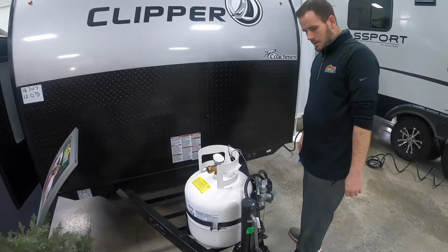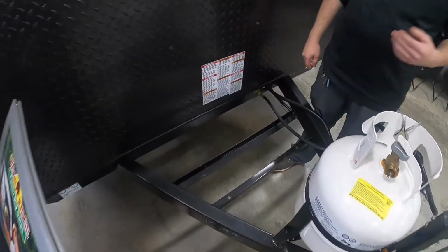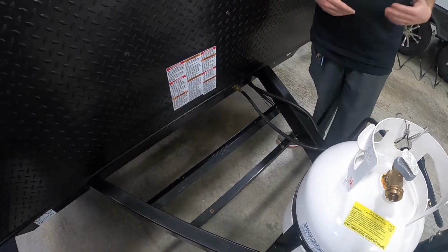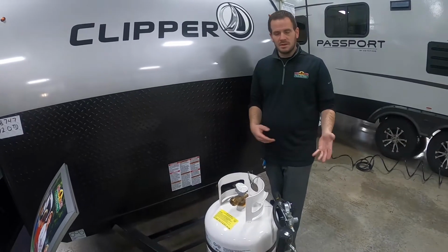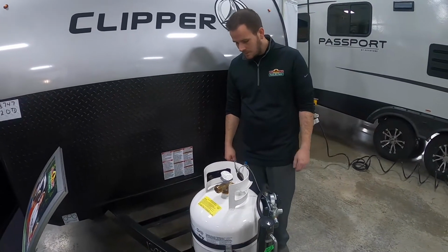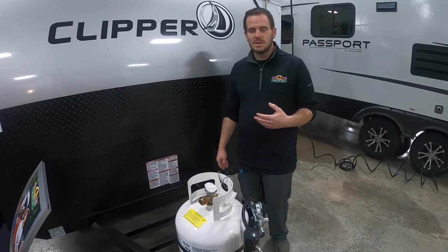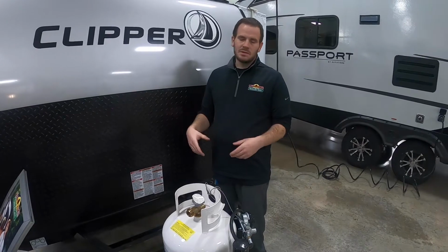Behind that you'll have a 12-volt deep cycle marine battery that's going to be able to run your lights and your water pump and little things like that. If you are dry docking or pulling over on the side of the road somewhere, your truck will be charging that battery at all times. The batteries that are on there are not maintenance free, so it's something you want to check every 6 months or so. Just make sure there are two little caps on the top of the batteries.